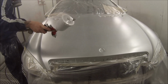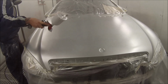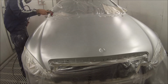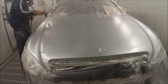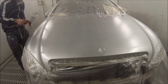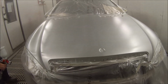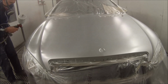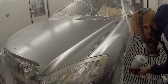You can put it on a little bit wetter, you can put it on a touch lighter, but as long as it's even. Basically, if you're starting at one side, you should see how my spray gun evenly meets up to the top of that guard in a straight line. If I'm back there and I start to veer off track, then it's not going to be put on even. You're going to have heavy spots and dry spots. So that's what I found is the key.